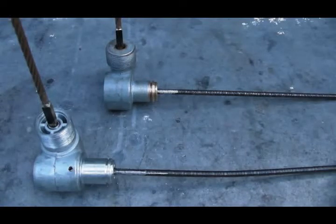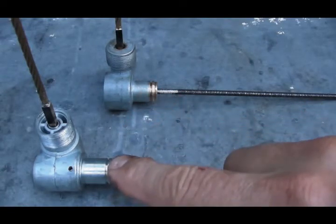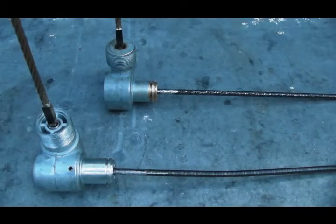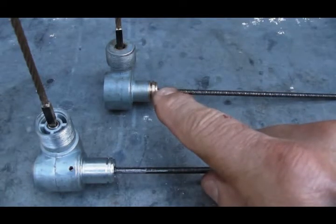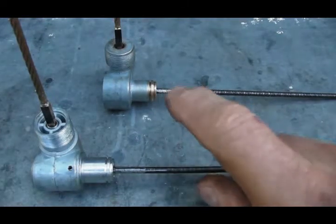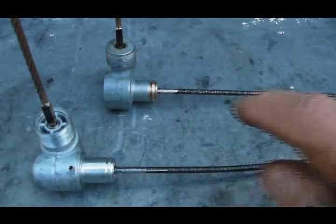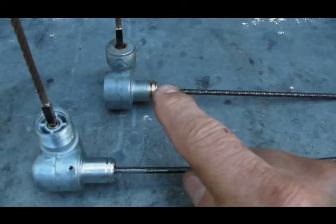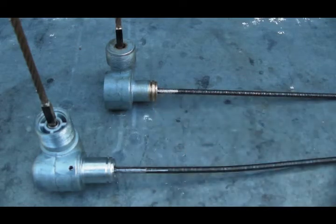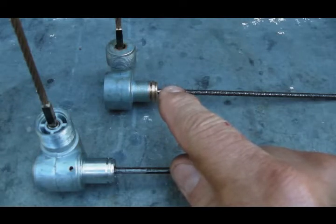This is a video showing the difference between an angle drive with an 8 to 9 gear ratio and an angle drive with a 1 to 1 gear ratio. This is a reproduction of the angle drives that would have come with the car. It has the exact same housing as a Smiths angle drive, has the same gears inside as a Smiths angle drive, and it behaves just like the angle drives that came with the car. This angle drive is virtually indistinguishable from an original unit.